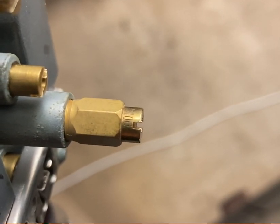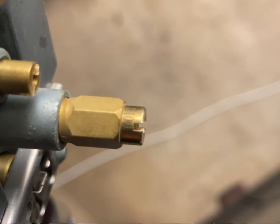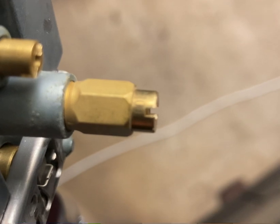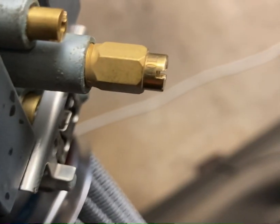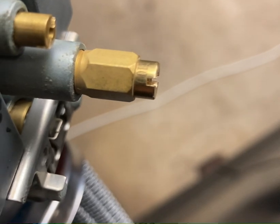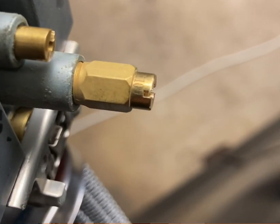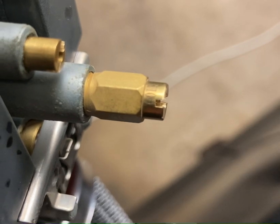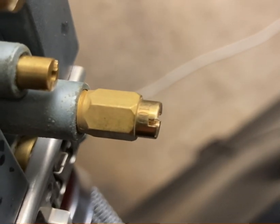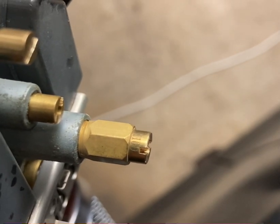After the 110 I was like oh my gosh, we are so fat on this jet. I went back inside, checked a couple forums, and I must have a misstamped original jet — what looked like a 108 was actually an 88. From everything I see on forums and websites, the stock TBR7 comes with a 35 pilot and an 88 main jet. That's why the 125 didn't work, and the 110 didn't work either. I also tried the 110 with one and a half turns on the idle screw — the idle mixture screw should be around two full turns out depending on your elevation. I'm going to go with the 100 and give this another go.